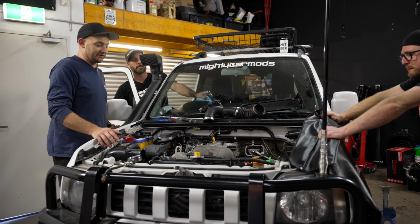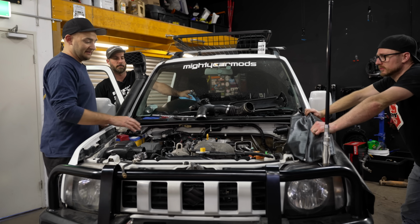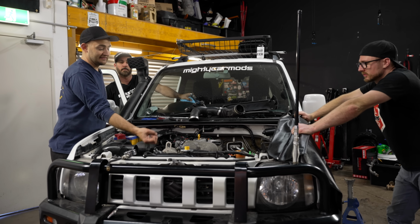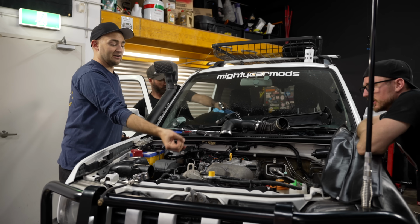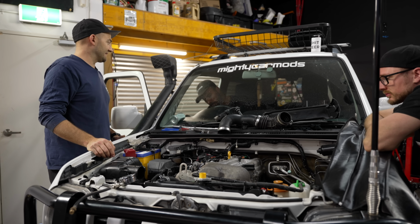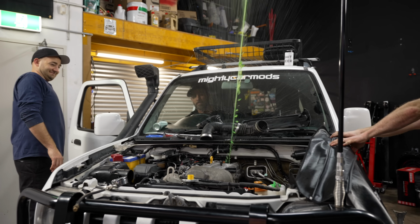We have put new oil in it. It's still draining a little bit of coolant out the bottom of the radiator. We don't want any water in this system. Now we've taken the spark plugs out. We're going to crank it, because if there's any water left in the cylinders, it's going to go pa-twink. And if it doesn't go pa-twink, then it's either getting out somewhere else, or I guess we're going to find out. All right, here we go. Hey!